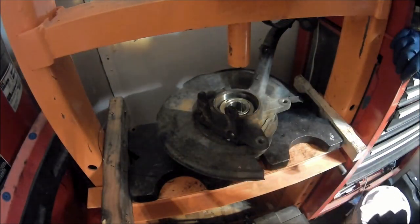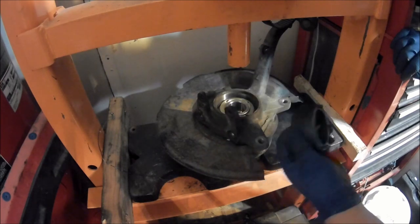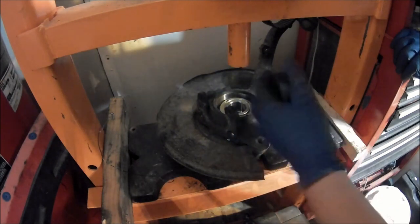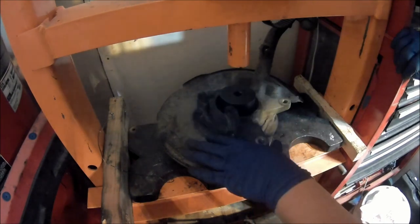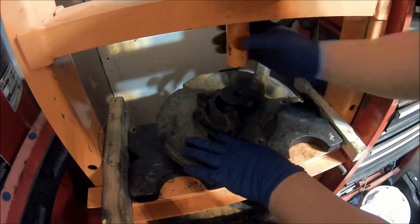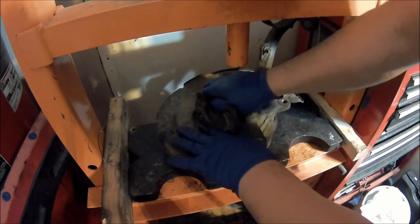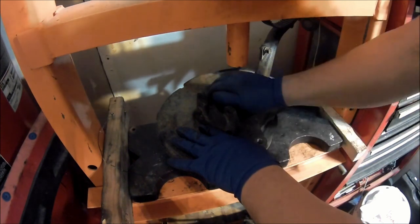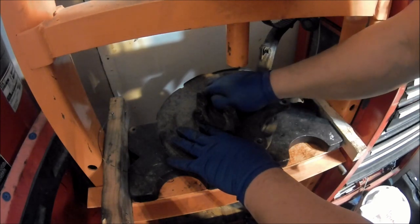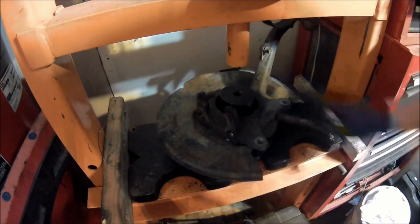The reason I'm setting it up like this is that this thing is going to want to walk, because when you're putting the torque needed to knock this nut off, it's going to wobble and not stay down. When I put the wrench this way, it helps keep the socket from walking. Since I don't have someone else to hold it down, this is the best way for me. Some people bolt it into a wheel, but you still need someone to hold that down too.